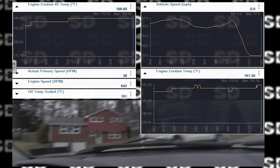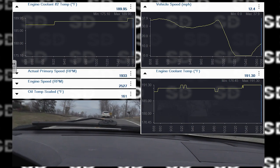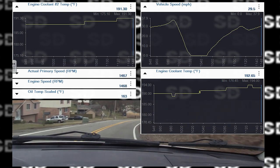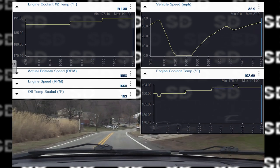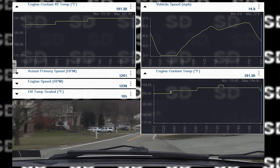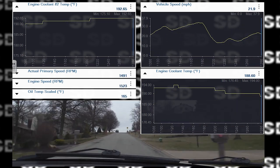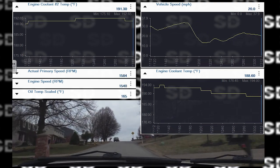You got some wiring issues on this. Turn signal was blinking normally and then started blinking rapidly and dinged at me. That also has an initial first gear, like when I pull out, light throttle surge. Power steering whine. Got multiple issues with this car right there. What is that?